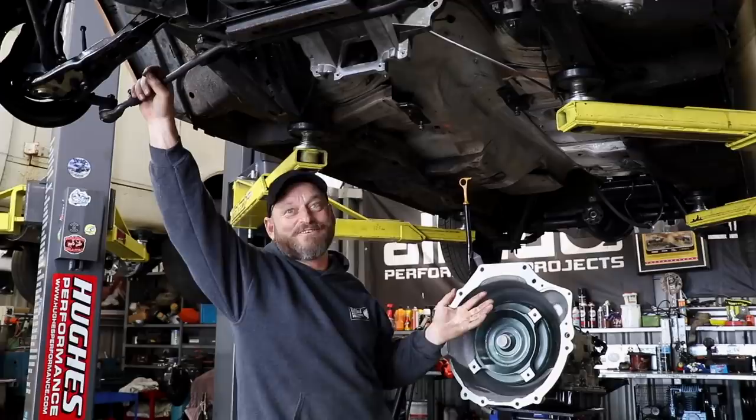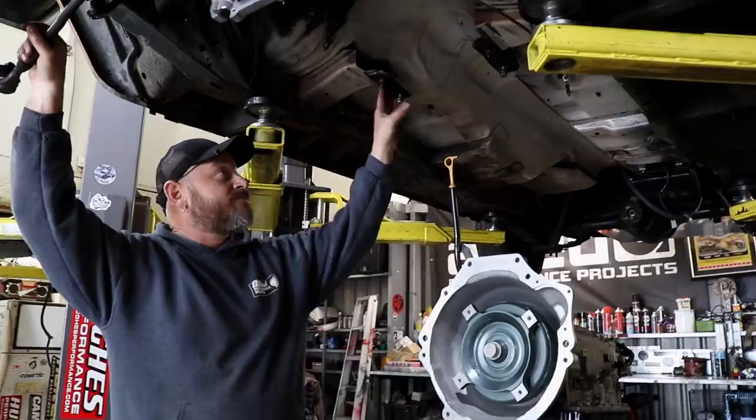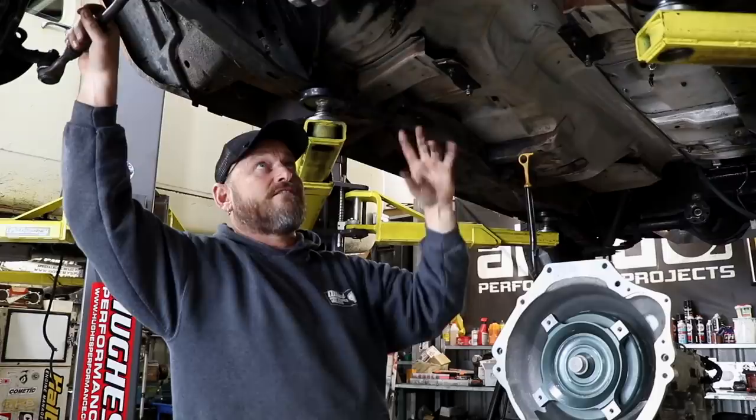The catch is we're obviously using a Nissan gearbox, which I doubt anyone's done before. But we already had the box and it's already modified for manual shifting and that sort of thing, so we may need to fiddle around with this. I've already adapted this transmission to sit a lot further back than the original one back when we did the VH41 conversion. Tape measure says it probably won't go too far off being correct, so that's a win.